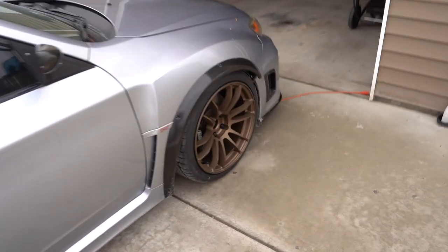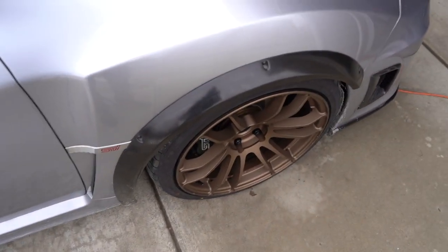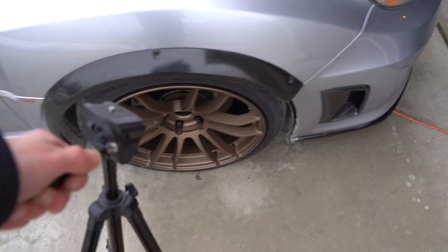We'll do it all at once, because you know, you gotta essentially take the control arm off to lower it. I normally take everything off except for the one bolt, and then I can spin the coil over. I don't know if there's an easier way to do it, but it's pretty easy, so. All we got left is the front up here, and I'm gonna go warm my hands up because they're freezing, and then we'll come out and do that one.